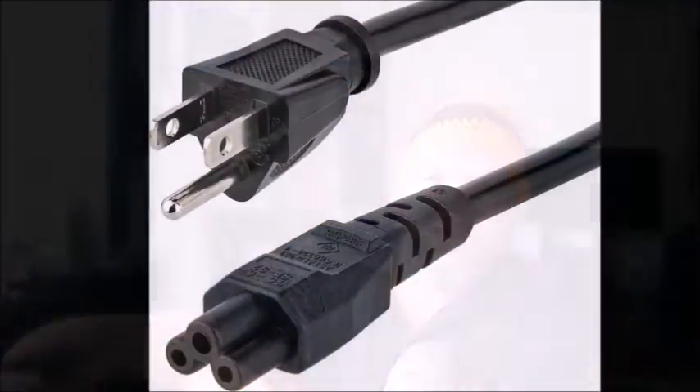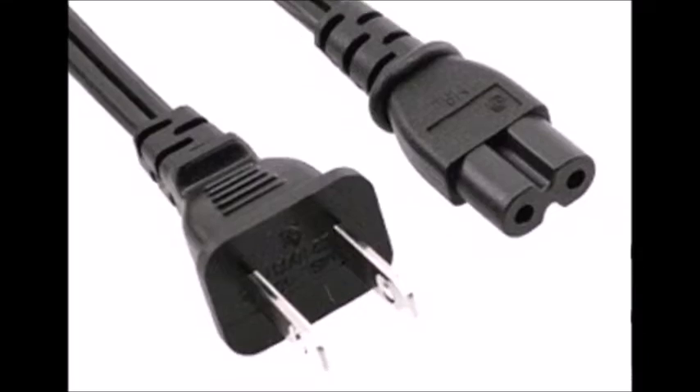On this particular Dell, the light is on the power cord itself. If the laptop does power on, it's probably not going to be the power cord that's broken. If you realize the power light is off, it could be the power brick or it could be the AC cord that goes into the power brick. There are usually two kinds for laptops: a three-prong power cord, and a non-polarized AC power adapter — a figure-eight symmetric cord.